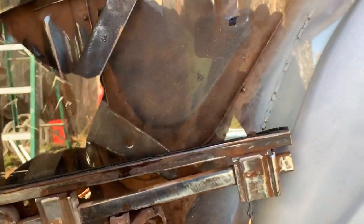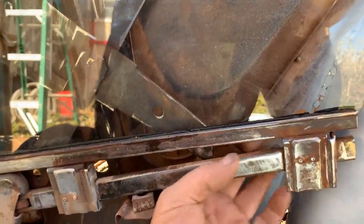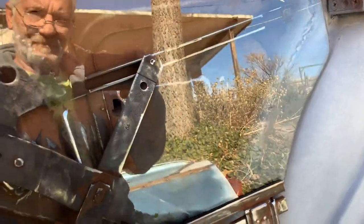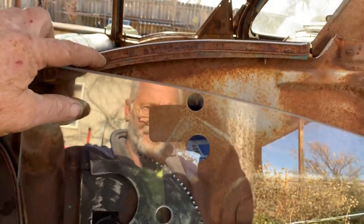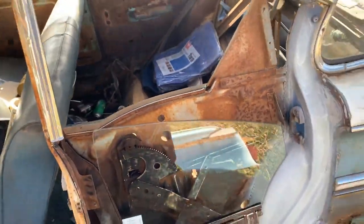I'm going to want to do a little adjusting, and there's a screw right up here. You can loosen that screw and it'll pull that glass away. Normally this glass would be spaced out a little bit with that fuzzy weatherstrip on the inside — the sweep, as we call it. That's what your glass looks like down inside.